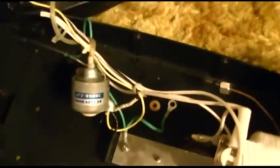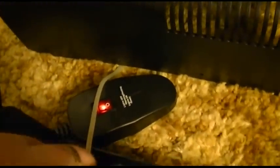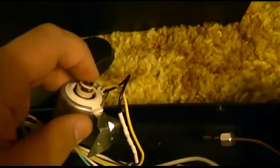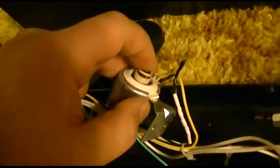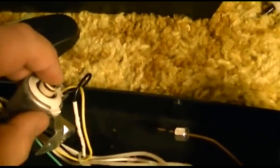It blew off the plastic piece and my O-ring, but they're there, so I'll put that back together. Never ever work on something with the power on, but because I'm a ninja... safety third. Anyway, plunger's back in. The way it works is that spring and the electromagnet moves this thing up and down, and that's what creates the pumping action to suck it up from the reservoir and through the pump, and then ultimately through that thing which also has its own O-ring. I'm going to put everything back together and we'll see if we can make it work.